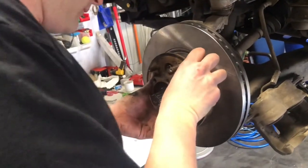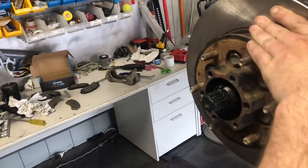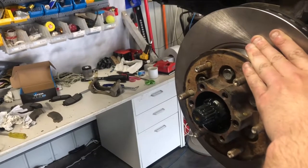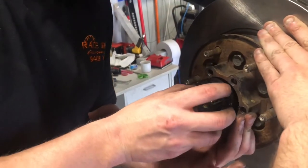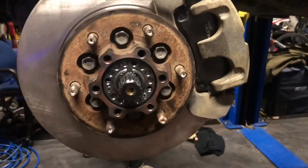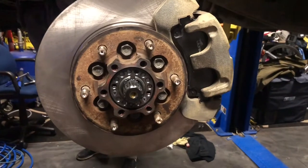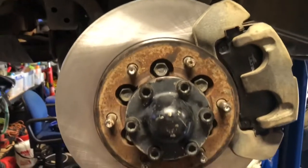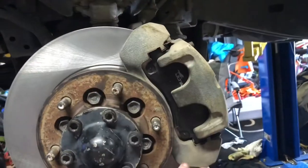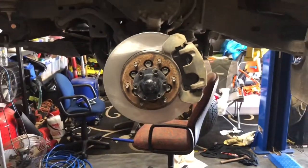To fit it back on, it's obviously the reverse of what we did. Putting everything back in, you've got to do your bearings very carefully, making sure you get everything back in the same order, that it's all re-greased and inspected. Slowly reassembling — if you've got someone to give you a hand it makes it a lot cleaner. When it's all together it should look like this. You can see the new brake pads in there. We're not going to go into detail with the pads because they're pretty simple — just wanted to focus on the complicated bit, which is mainly that rotor and bearing assembly, and how to fix up your whole front end on the 2017 D-Max. Victorian Fishing and Camping Adventures — subscribe!